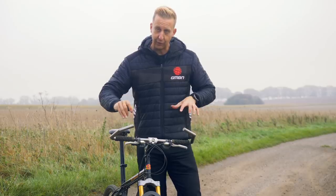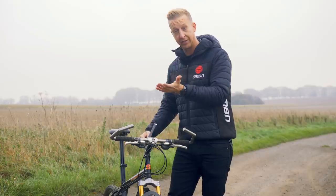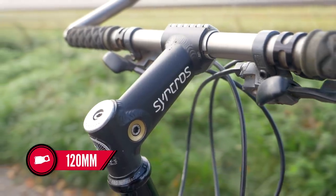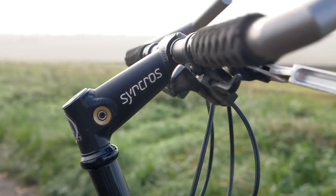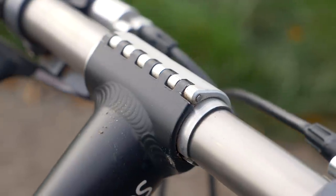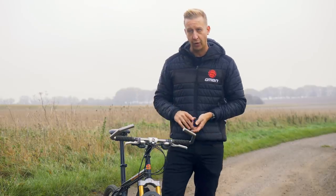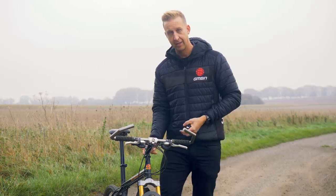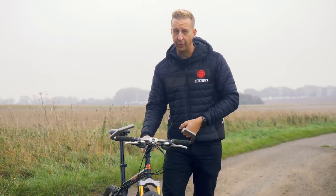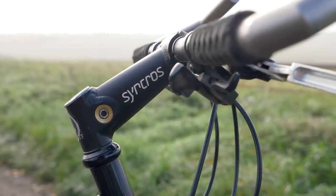With 570-millimeter bars you have to cram in two sets of gear shifters and your brake levers — everything is extremely compact. The stem is a Syncros stem, about 120 millimeters with about a 30-degree rise — quite an angle compared to the zero-rise stems we have today. It's got a bit of a hinge held together with Allen bolts underneath, as opposed to a regular faceplate with three or four bolts. These stems were everywhere at the time, and when the Ahead system came out, they were one of the first to have what we called a knee saver — the twin pinch bolt was incorporated on the inside rather than protruding at the back, which really did save your knees.